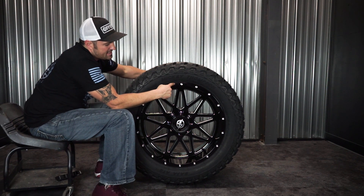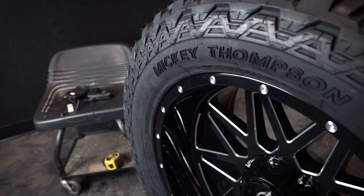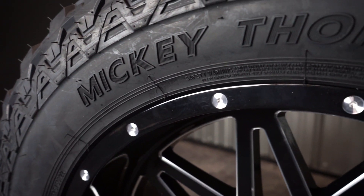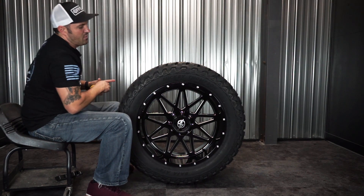Because you've got this 10-wide wheel on a 12.8, almost 13-wide tire, it's going to give you nice sidewall protection — a little bit more of a bulge there. Not really that straight up-and-down look you'd have on a 10-wide with an 11-inch wide tire in that range, so it's going to give you a little bit more.